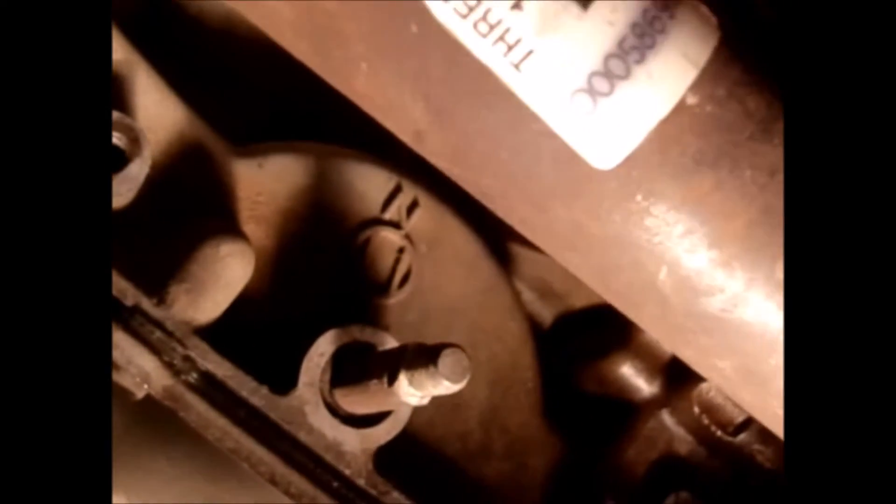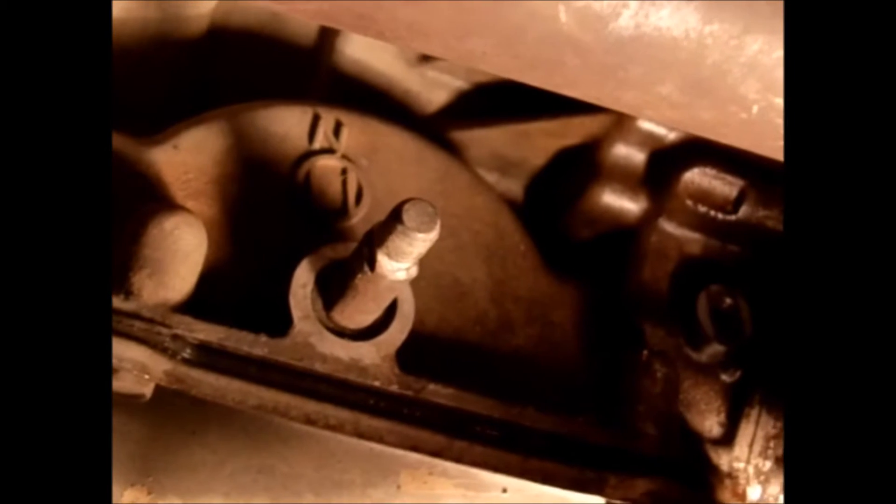Here's the lever I was describing. Grab the notch and go all the way clockwise until it stops, then back it up two detents — one, two — and that puts you in neutral. If you look on the transmission case, they've actually stamped where the shaft should be positioned when in neutral, but that's hard to use with the transmission in the truck. Let me slide the switch on and show you the rest.